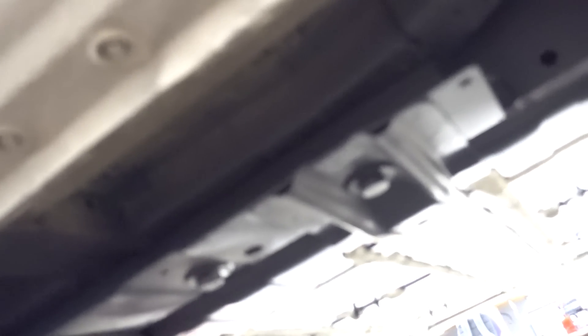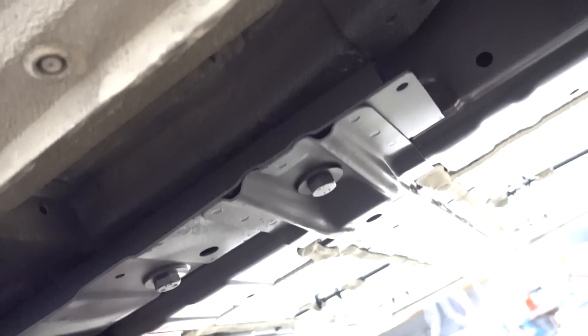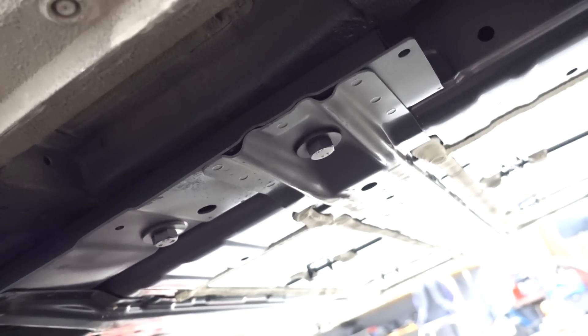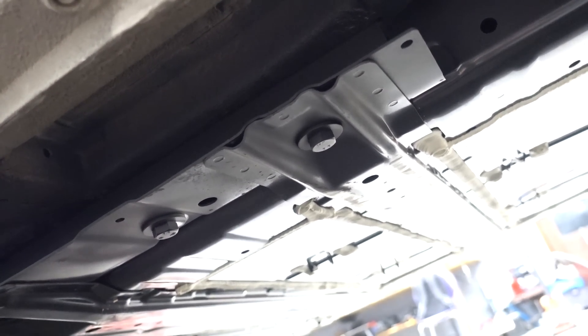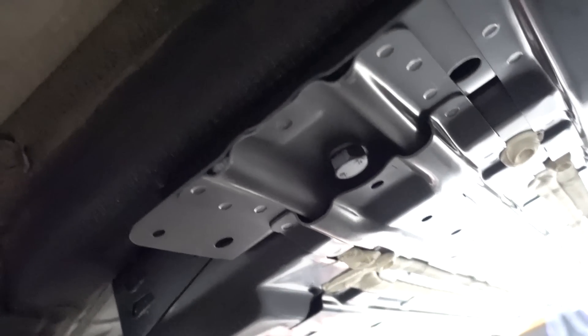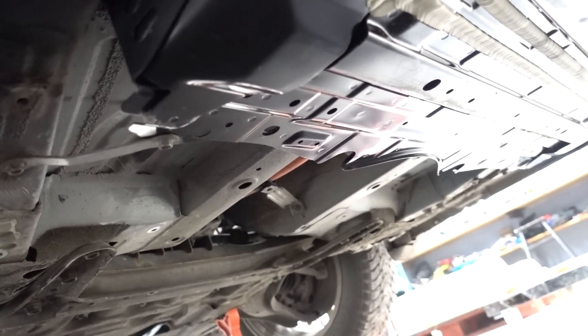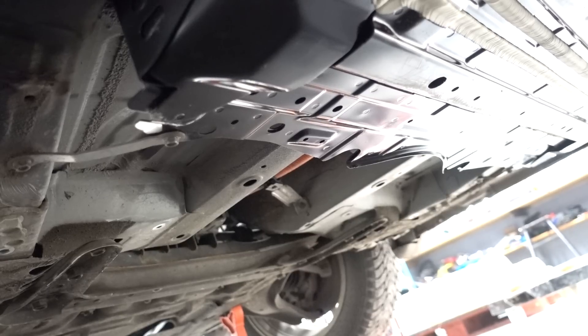Rolling on down further to the front, we can see that the pack is bolted in — we have this adapter plate sandwiched in between. I'm gonna have some pictures in the description if you want to replicate this. This goes all the way to the front here, also bolted in via the adapter plate, and the two original mounting holes for the front — those actually fit without any need for modifications.